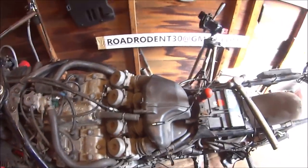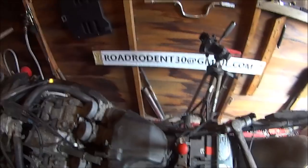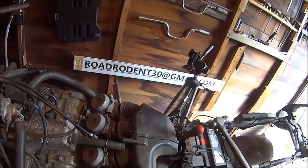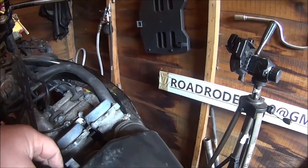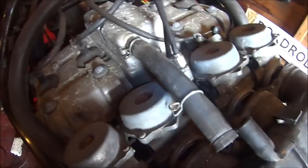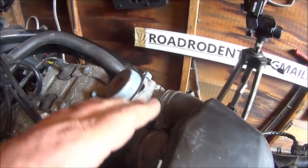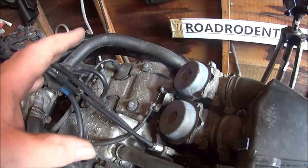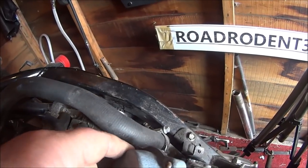So this is the next day. I'm stuck on one little cross-head screw just to get this stupid air filter box out. I think I can get the carburettors off first because there's plenty of room. When I pull the airbox back I should be able to get the carburettors out, and when the carburettors are out of the way this air box will hopefully come forward and lift out so I can get that stupid screw out. But it's still not as easy as it seems.